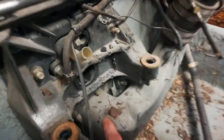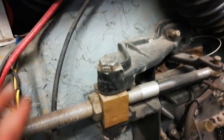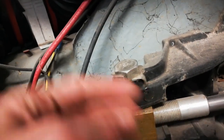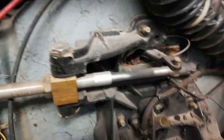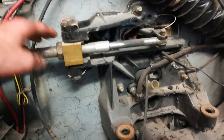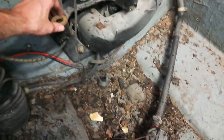What we're going to have to do for getting the transom assembly off — as you can see there's all these bolts, so we'll have to get those off. I'll take this exhaust piping out from right there. You can see there's one, two, and then on the bottom another two bolts go into that. Then on the steering here there's a bolt on top with a little holding pin you got to bend up to get out of the way, and then another one on the bottom. Over here there's one of those little clips on the bottom, so just slide that out, then you can pull the pin up and we'll be able to get the steering out of the way. We're going to need this shifting cable — it goes all the way through the transom — so we'll have that laid out straight so it'll be able to pull straight through when we take it off.